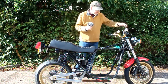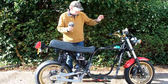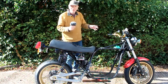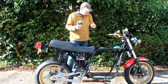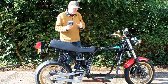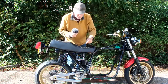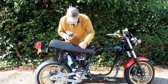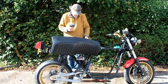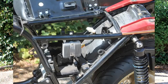I'll start off by wiring up the headlamp, indicators, rear lamp, and rear indicators because that's pretty straightforward. The wires go from the front and back of the bike towards the center to the M unit. All I've got to do is work out which wires do what, add some connectors, and extend the wiring back so it reaches here. I'm going to run all the wiring on the left-hand side. Since the M unit is on that side it's got to come underneath the seat, across and over. There's plenty of room just above the battery tray so no problem there.